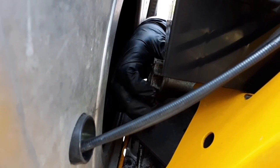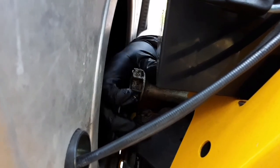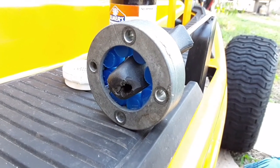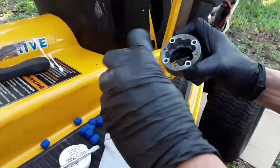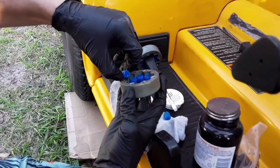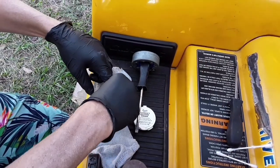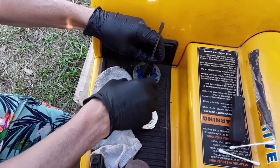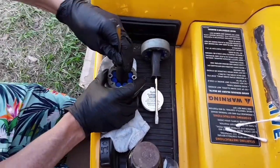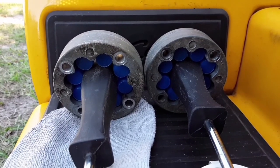Grease up the end of the driveshaft to make the couplers slide in easier. We're waiting for the rubber cement to dry — we stuck a screwdriver in the middle to hold it in place, then we'll slide it onto the end of the driveshaft. We're going to glue the rear ones in right away while we're waiting for the front ones to set up.